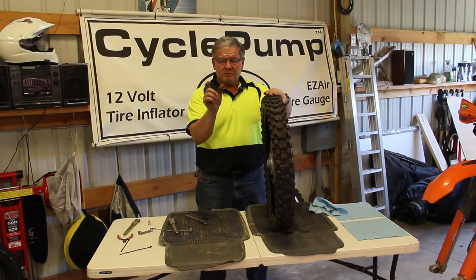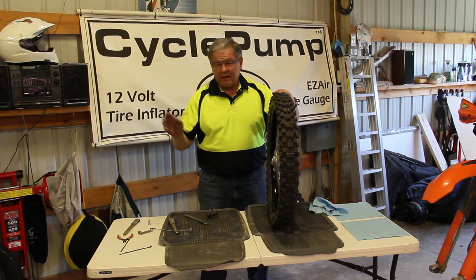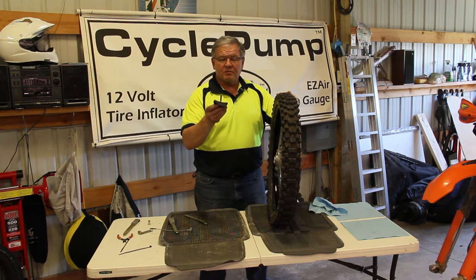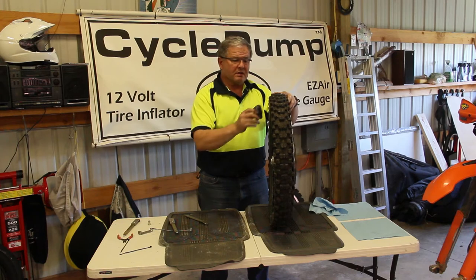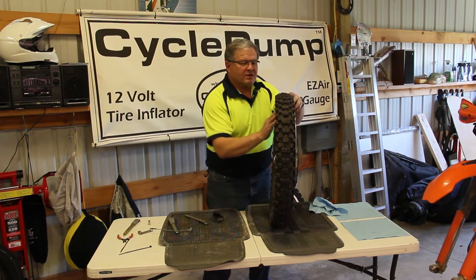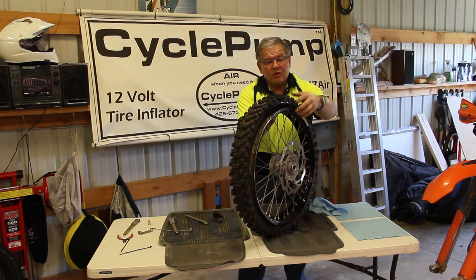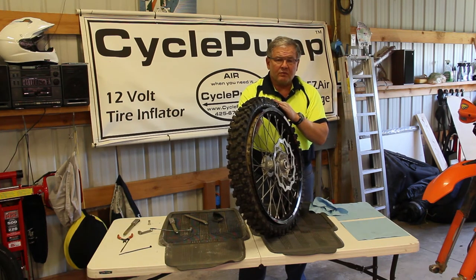Now I'm going to show you how to work with the narrow width rim front tire off the KTM 450. It's got both a rim lock and a valve stem off the tube. The dilemma is I've got to get this large block of rubber inside the tire down through the hole into the rim. As I reach up inside and try to work, again the tire moves toward my hand and the hole is inaccessible — it's in the center of the rim and physically impossible to fit. That's why some guys will mount the rim lock before they mount the tire.